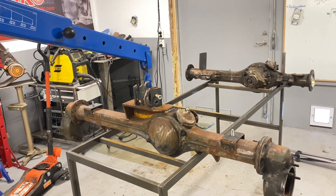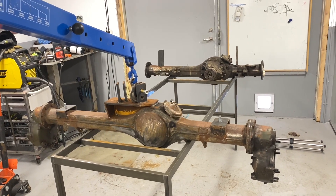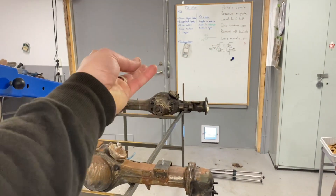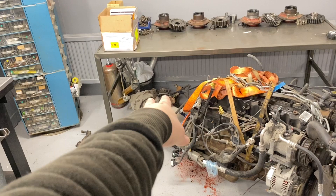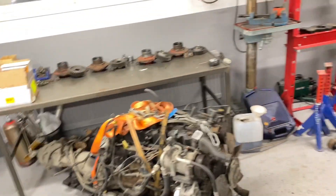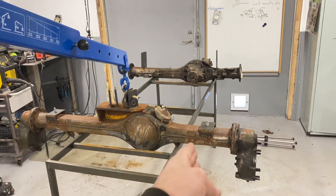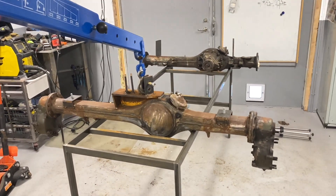That's the plan. I've been thinking a lot about all the alternatives — flipping the axle, getting a Dana 300, even flipping the 231 Jeep transfer case upside down — but I think the best way is to actually convert the rear axle housing to a front axle to get the pumpkin closer to the tire and make enough clearance for the driveshaft.